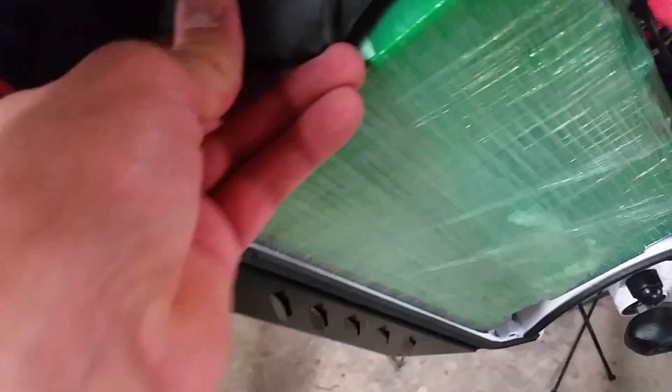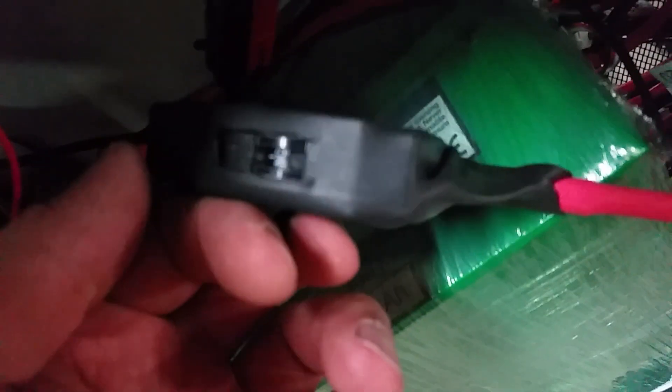This is your circuit breaker — this is your DC 100 amp breaker. Right now it's in the on position. To switch it to off, you have to use a small screwdriver to flip the tab into the off position, and then a screwdriver to flip it back on. I removed the handle on that just to keep it from accidentally tripping inside, as a safety precaution.